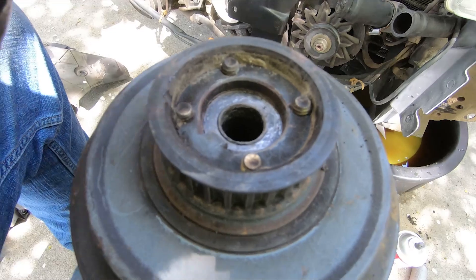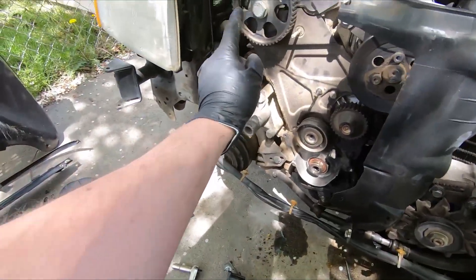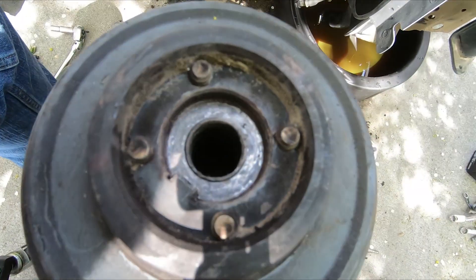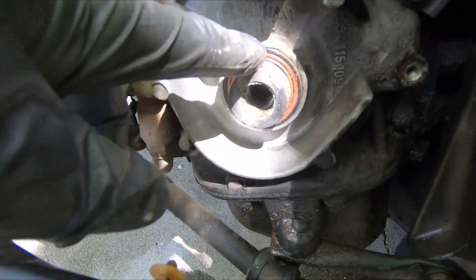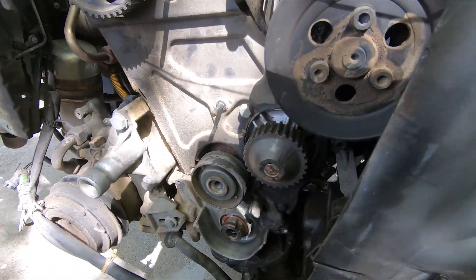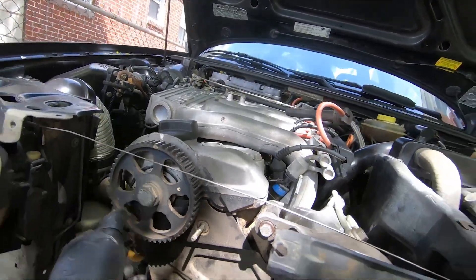Other things to inspect: this is your harmonic balancer — never use impact tools on it. What you'll normally see is cracks right along the keyway edges. If you have a crack in the keyway, replace it absolutely immediately. I don't like to remove it if I don't have to. The cam seal is working great, the crank seal is working great, so I'm not removing either. I still need to pull the water pump and the backing plate, and I need to adjust the crank one tooth before reinstalling the new belt.